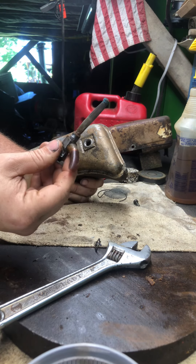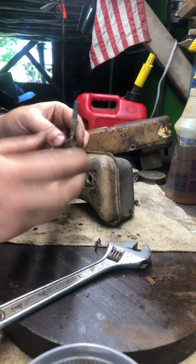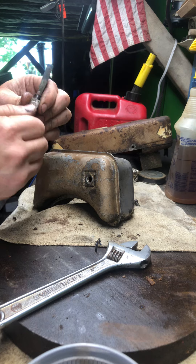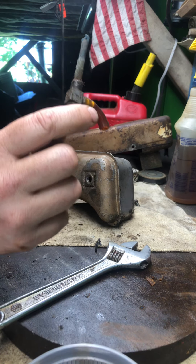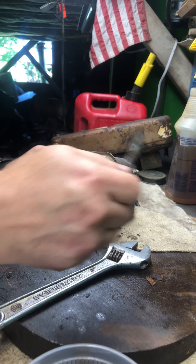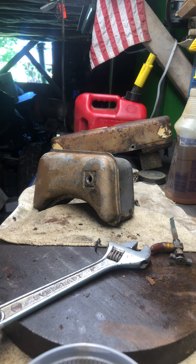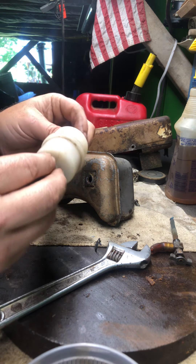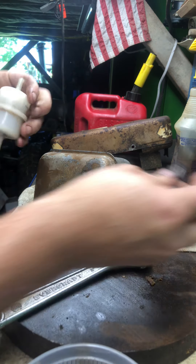So there's the screen. That's why a lot of these mowers don't have the inline fuel filter in them — this screen is what they use. So all the dirt stays in the tank, which is fine. Versus putting an inline filter on where the dirt goes in there.